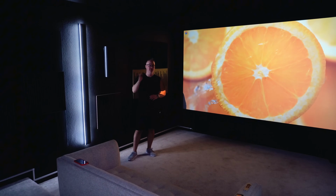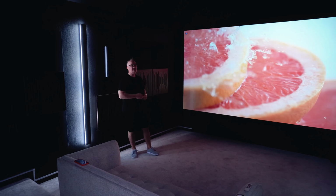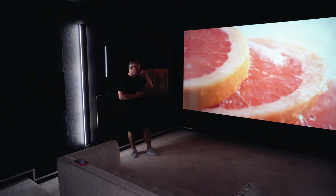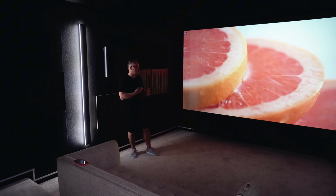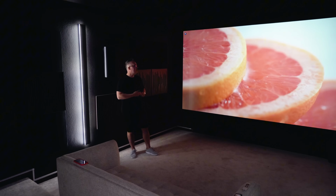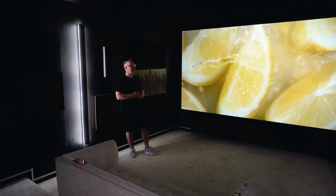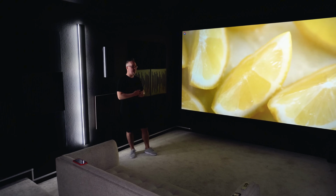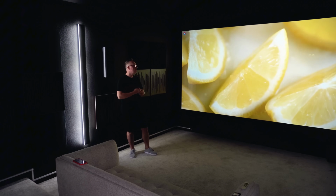But we've got great video in here, just absolutely phenomenal video. This is running at this brightness only 65% of the lamp right now. No reason to put it any brighter. I calibrated the video. It's just super amazing. Great black levels, which we all know I don't believe in anyways, but it does turn off the black pretty good, under 1 lux, as you'll find in the other video. And then this is running about 380 lux, even at 75% brightness or so. So ultra bright projector, really great contrast ratio. That contrast goes above and beyond THX standards, so it's really great.